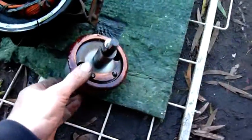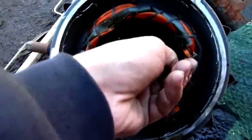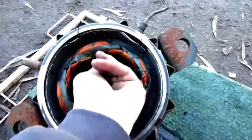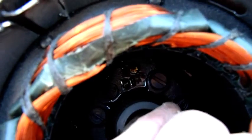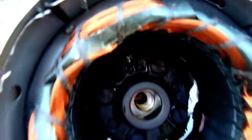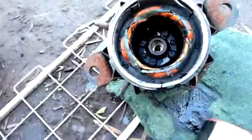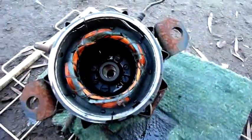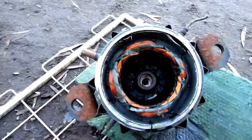The rotor just fell out. It seems to be some kind of primitive rotary — there's an eccentric lobe and down inside a little plate. I'll try and get that assembly out. Oh it is — it's a rotary. See the vane in there? That would probably mean the outer housing is the high side. Yeah, it's a rotary compressor.